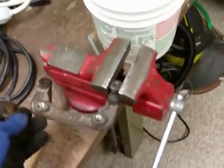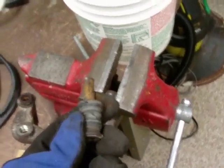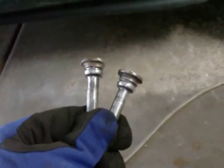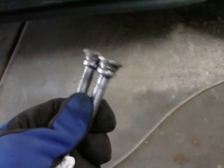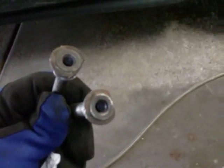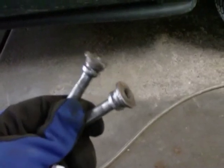I'll use a wire wheel to get these things shined up. I probably ought to replace this part but I'm not sure if the local store will have them, and I'm not inclined to go out and get them now. I cleaned up these caliper pins for this 97 Taurus — I probably ought to replace them — but before I did these on a wire grinder and wire brush, they were really bad. Notice the notch on the tops of those, as that fits into the caliper support. Apply silicone grease to keep these moving.